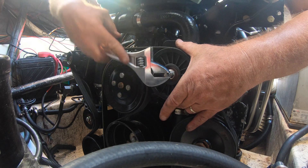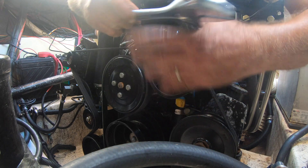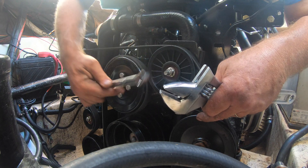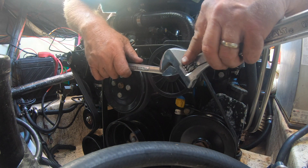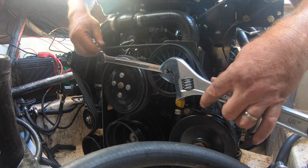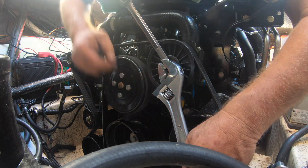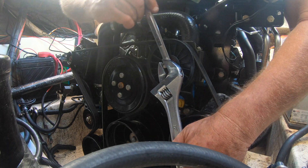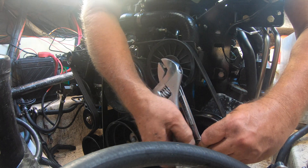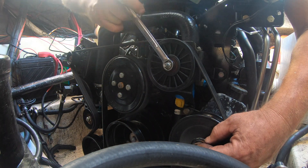Then you don't have to get it up over the lip of the pulley — you can just slide it right back over, and then tighten up the pulley that tensions everything with the crescent wrench. When you rotate it clockwise it lifts it up, and then you just cinch up that inner nut. When I initially tightened up the serpentine belt it was just a little bit too tight, so I ended up backing it off just a little bit. It doesn't need to be super tight — you don't need it to fly off, but I didn't want to prematurely wear the belt out.